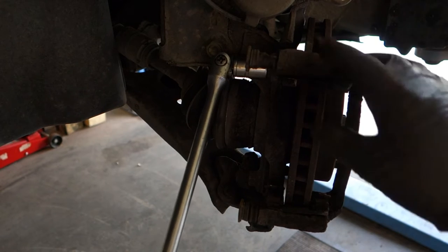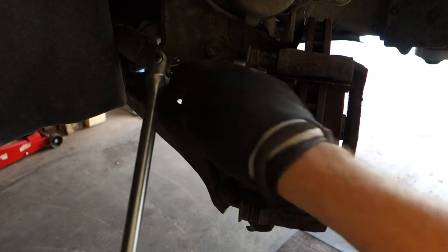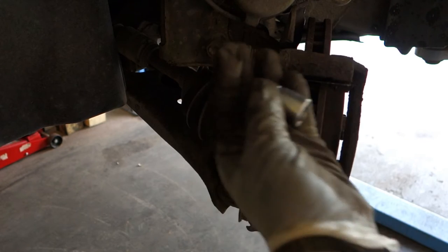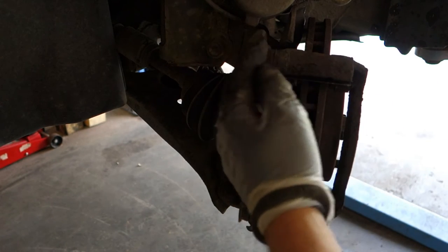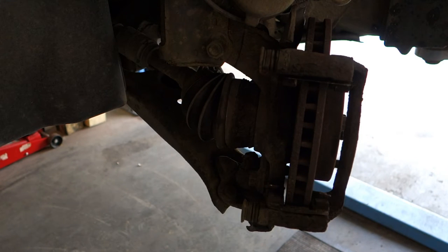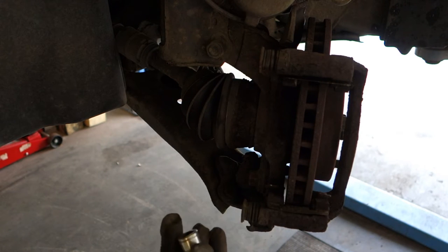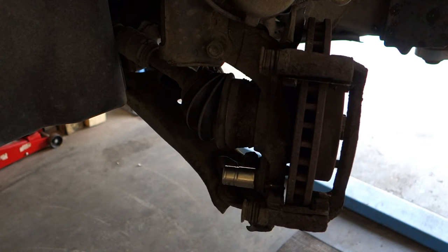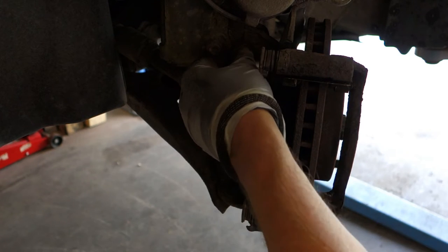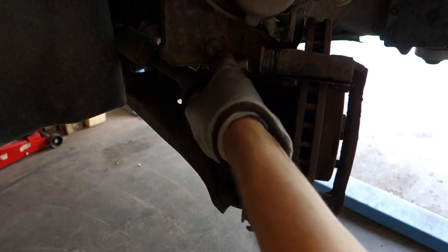Okay, and then when I am planning to take this brake caliper support frame out, there are two bolts. First one is in here, and second one in here. For that job, we need a socket. What size is it? 17, and it fits in here, in that way, and then in here in the upper one. And please clean those bolts carefully, and then it's easier to open.